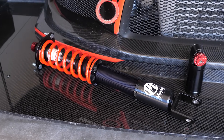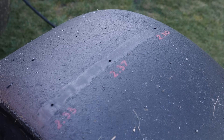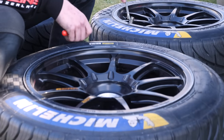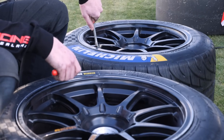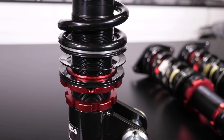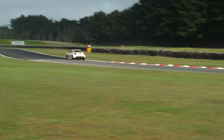Playing devil's advocate: if you've got a racing damper where compression and rebound damping is adjustable, on face value you could get it into a window to suit your car. But you're saying that's not necessarily the case? Correct. We are always chasing the tyre — almost everything we do, we're looking at the tyre to make sure we've done a good job. The range in which you're allowed to operate may not be suited to a semi-slick or a slick tyre. There is some play, but nine times out of ten, safe is not necessarily fast. They may give you a very small compression window and quite a large extension or rebound window, which keeps the car safe but doesn't necessarily generate lap time.